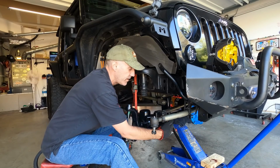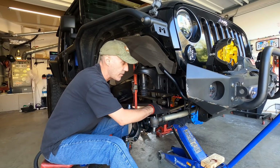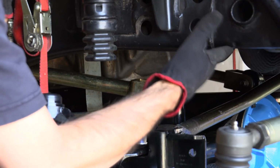The tricky part is if that's down here, you're going to get the axle, as it goes up in the up travel, it'll swing out this way and then up. So now you just get that part of the arc. That's ideal or better. We have it at my pre-measurements, which were for about ride height.